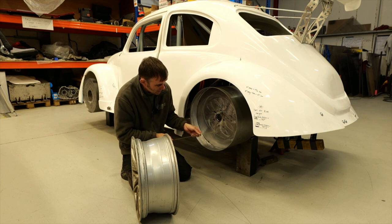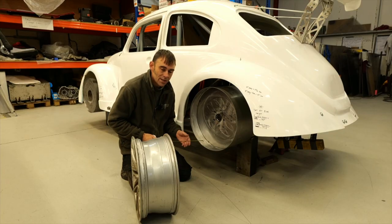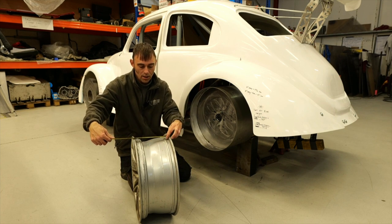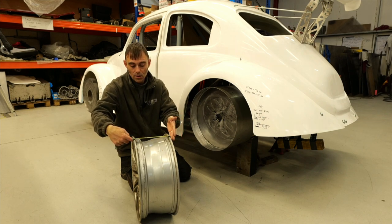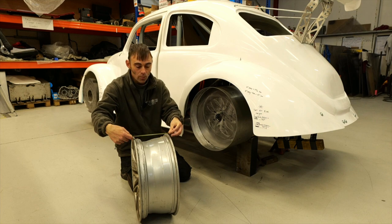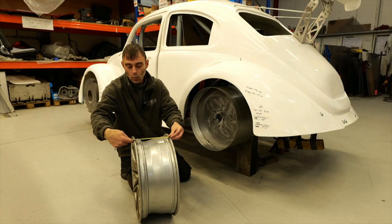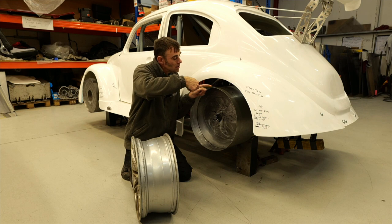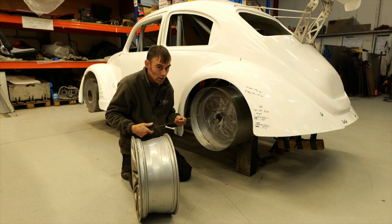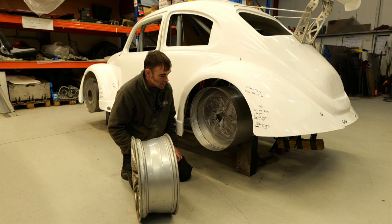Anybody that's picked up on the writing on here has seen there's an 11 inch rim. What does that mean? If you go with a 10 inch rim, the tyre size is going to be 10 inches but the actual overall wheel width is going to be an inch more. You can see it on here - this is an 8 inch wheel and the overall wheel width is 9 inches. So when we make these mock-ups we've got to make this bit 11 inches to accommodate a 10 inch wheel. As far as diameter is concerned, we're going with an 18 inch rim because there's lots of tyre sizes available with an 18 inch rim.